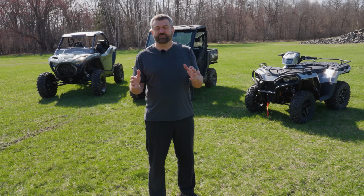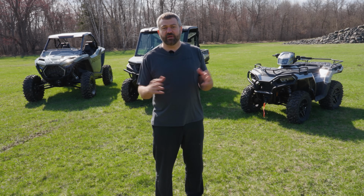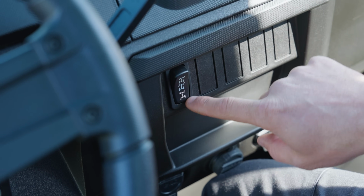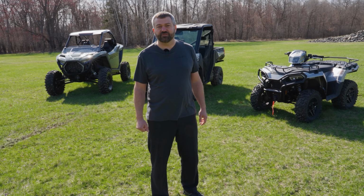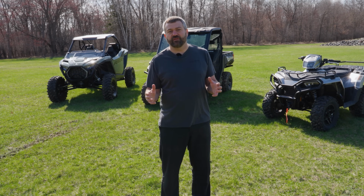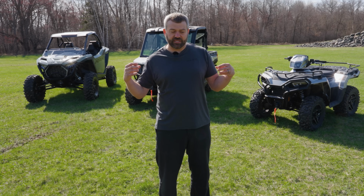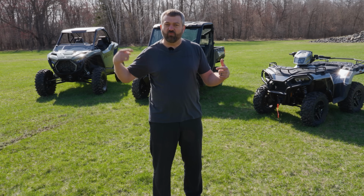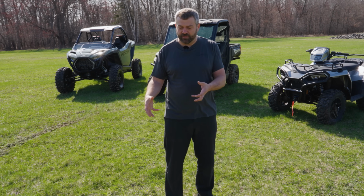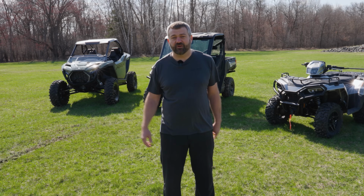All right, the next driveline mode we want to get into is the VersaTrack Turf mode, which exists across many of our side-by-side models, including Rangers, Generals, and Expeditions, and select Sportsman models like the 570 X2. Now, the cool thing about this driveline mode is that it allows you to unlock the rear differential. So instead of having both wheels spinning at the same speed delivering power, you basically have one wheel spinning, so you're not going to tear up things like your yard or the grass when you're driving around in fields like we're standing in right now.